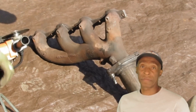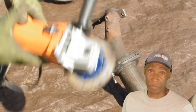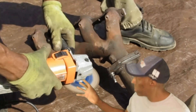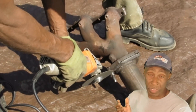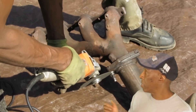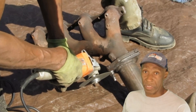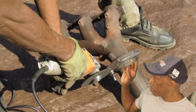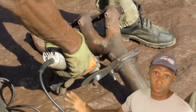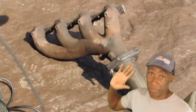Watching those videos and preparing for problems ahead of time helped me get past a lot of this — the bell housing bolt at the top, the exhaust bolts I couldn't reach, and getting my exhaust off. After doing all of this, I also realized that the right side manifold and exhaust — I didn't have to fool with that at all. On this vehicle, you didn't have to move it.